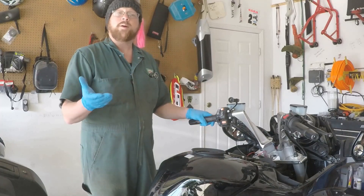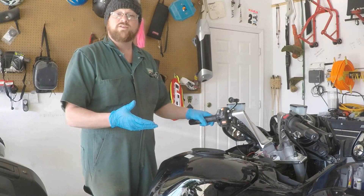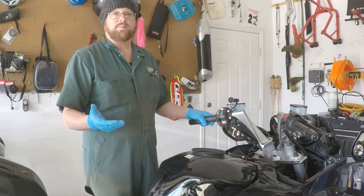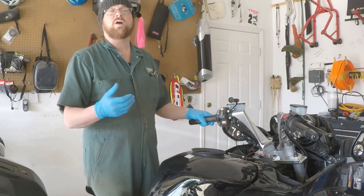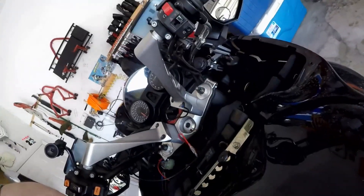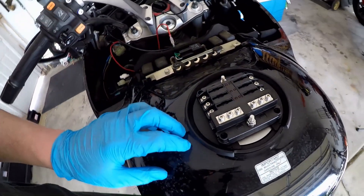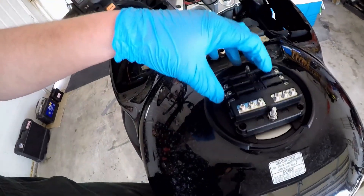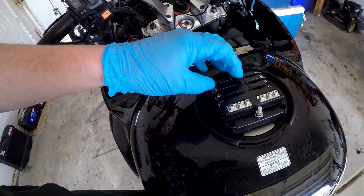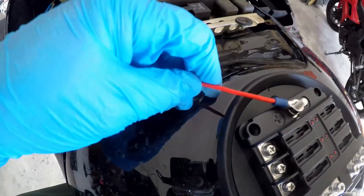So depending on your application, that might be all you need. If you're only ever going to attach one accessory to your bike, you could just attach the power wire from your relay to whatever device you want to energize and you'd be done. It'll turn on when the key turns on. But most of us are probably looking at attaching more than one component, and you really want fuse protection. This right here is our auxiliary fuse box — it's got a cover on it. We have a negative terminal, a positive terminal, and six circuits we can use with fuses. This particular block also has fault indicator lights, so if you have a short, one of these lights will turn on to show you which fuse it is. Our power wire coming off the relay is going to attach here to the positive terminal on this fuse block.